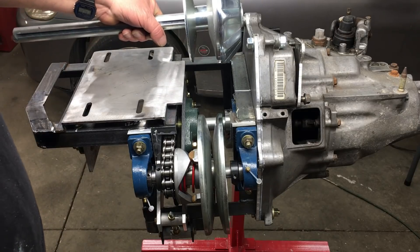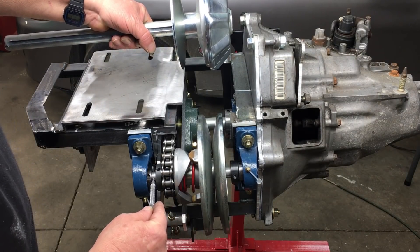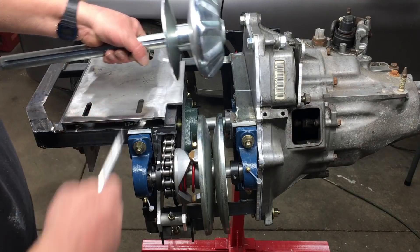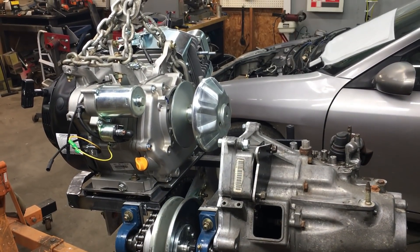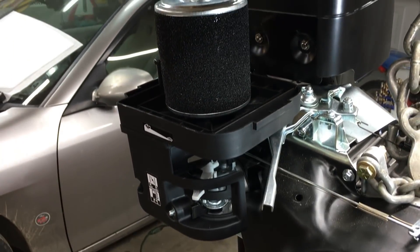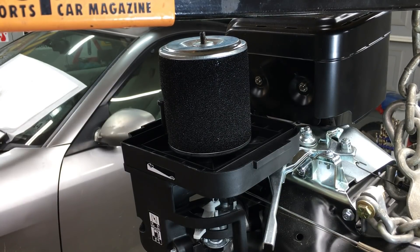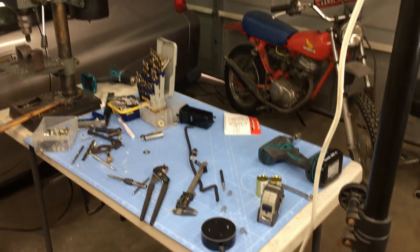Now another thing that has to be considered is the length of the torque converter belt. The belt length is determined by the distance from the crankshaft center to the jackshaft center. The shims that I use to push the jackshaft out can cause a problem with how the torque converter works. So to combat this, the engine mounts will allow the engine to slide back and forth, which will help compensate for any additional shims that may be added in the future. I temporarily set the engine in place and it's real heavy. The engine is rated for 13 horsepower out of the box. With a new custom exhaust, a different air filter, and some fiddling with the carburetor, we could probably add a few more horsepower even before we hit the street.